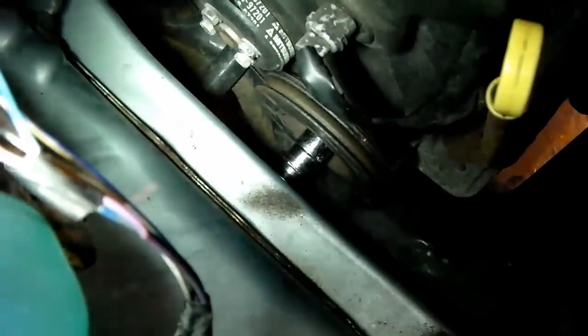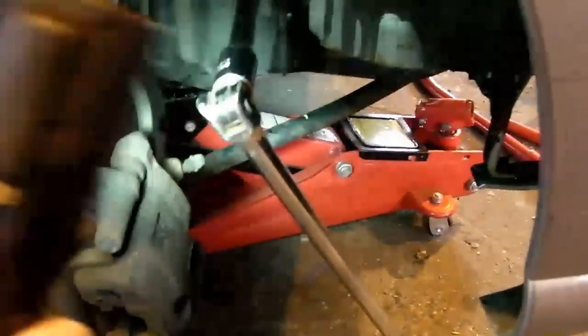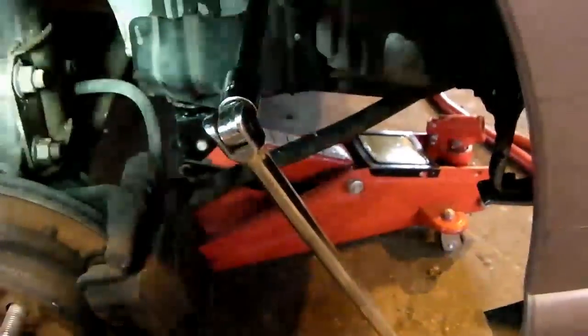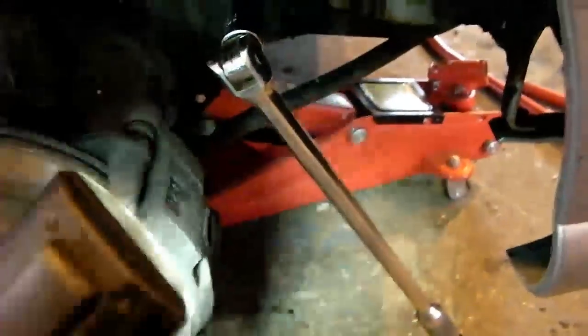The crankshaft bolt, using an old crude method, you can see there's a socket sitting on it which is connected to an extension bar and a breaker bar there. It's a very, very crude method, but it does work if you don't have access to impact tools. Basically, you place that on there, the socket bar, ideally if you can just use a socket and a breaker bar, but in this case the access doesn't allow that because of the chassis member underneath there.